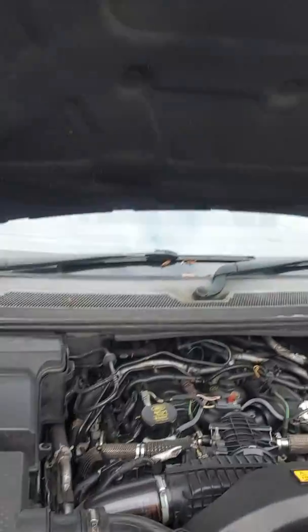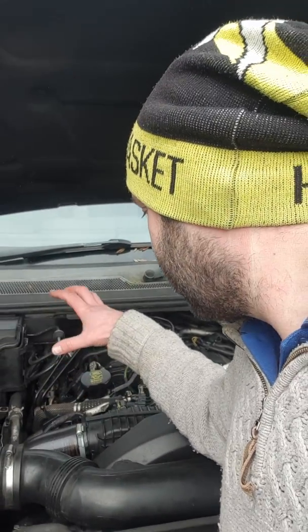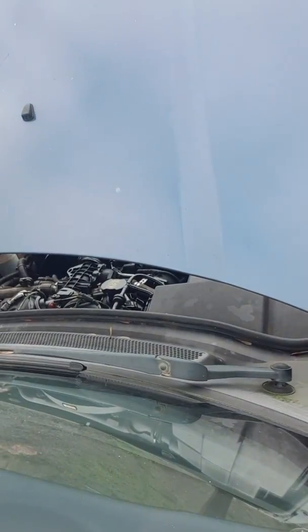There's nothing here, but a slight knock on this side, which is the driver's side. Can you hear that? I don't think you can. I'll give you a little bit of a rev — it's pretty slight. I can hear it. I wanted to catch the knock before it got anything major — that's why I went straight into the bottom end and changed those out.